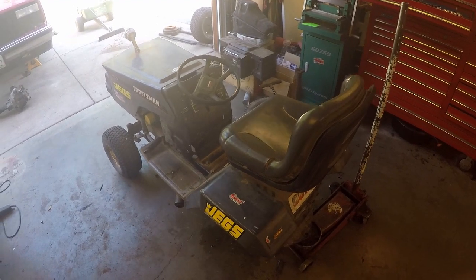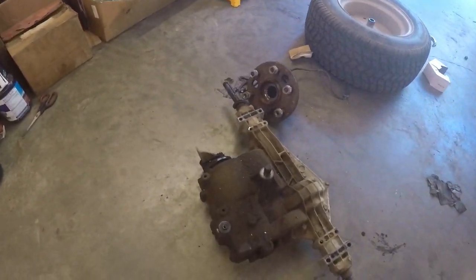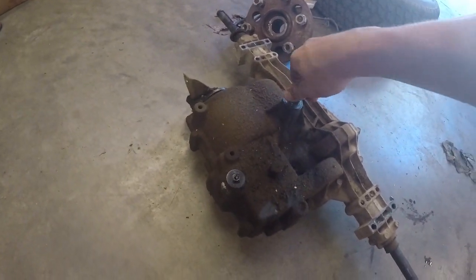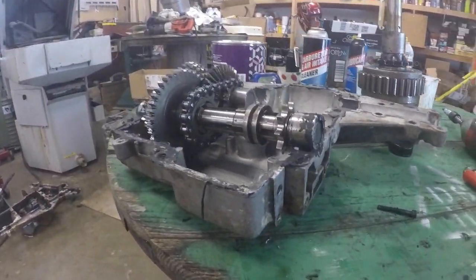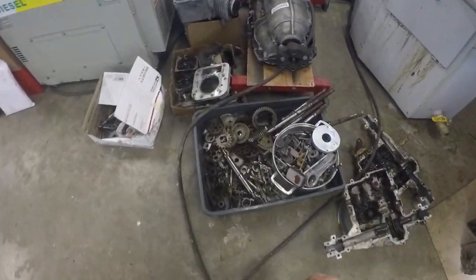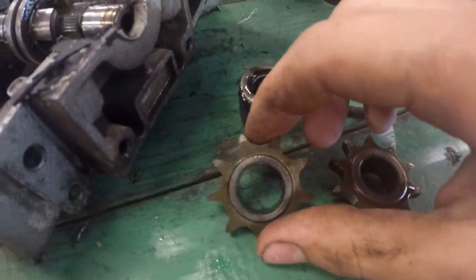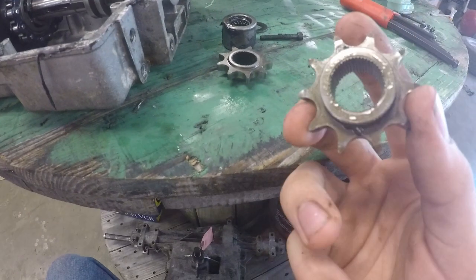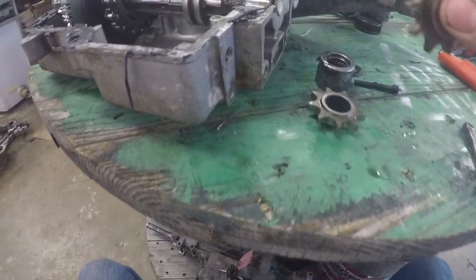So here we have the racing model. There's the MST-206 out of it. This thing's been in there for more than two years and I've done nothing to it. I just threw these gears in here so you guys can get an idea of what's going on. I've got a revolve chain sprocket — it's a 10 tooth. There's also a 9 tooth I've seen. One of the biggest differences is the 9 tooth is pretty weak, 10 tooth is a lot stronger. I'd definitely advise you get a 10 tooth revolve chain sprocket if you're going to do this.